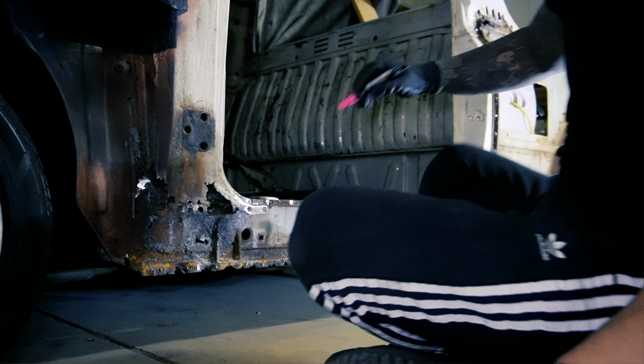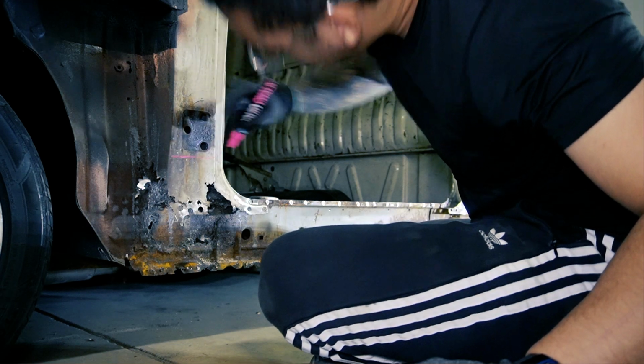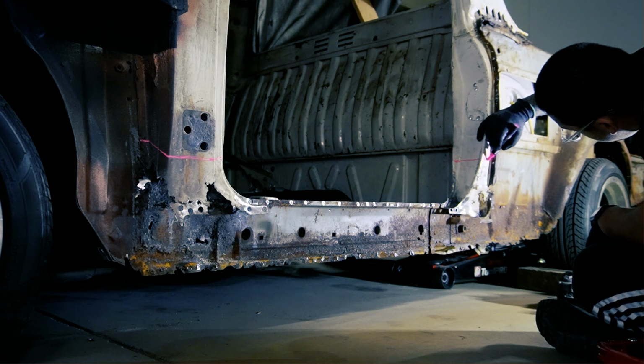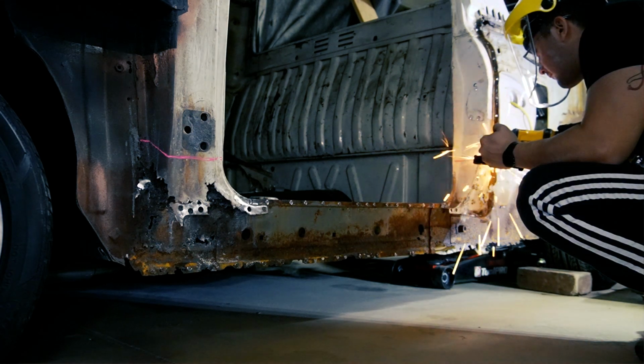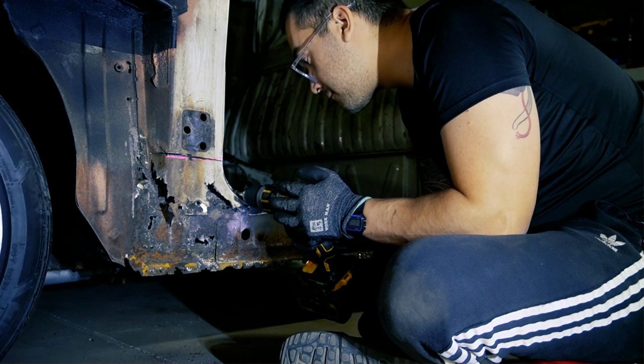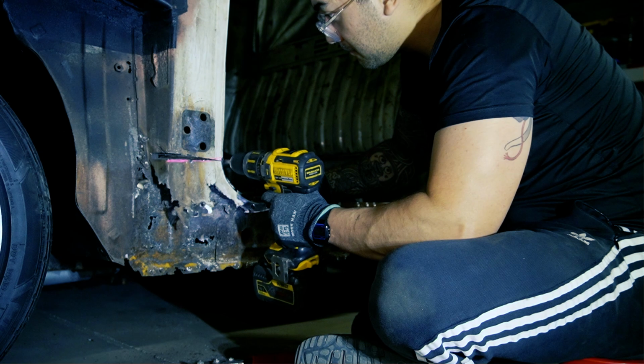These are the A and B pillar sections of the door jamb I was talking about. They're definitely gonna have to be repaired, and I'm going to need to reach the metal behind them, hence my decision to cut them right below the lower door hinge. That way I can more easily repair each layer.